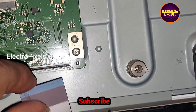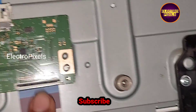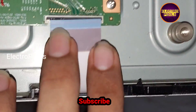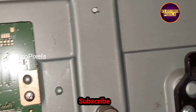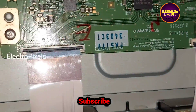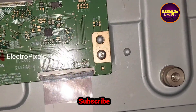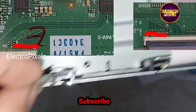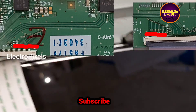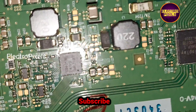We need to remove the blocking from the right side FFC cable. Now we removed the masking tape from the right side FFC cable. Now let's apply the masking tape on the left side FFC cable. Here you can see the markings for blocking the gate signals on the T-con board — the lines are marked. Now we have blocked the gate signals from the left side FFC cable.